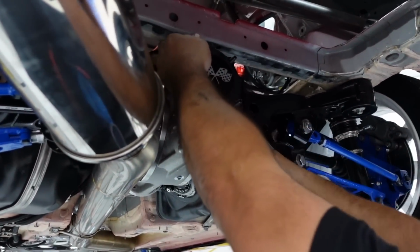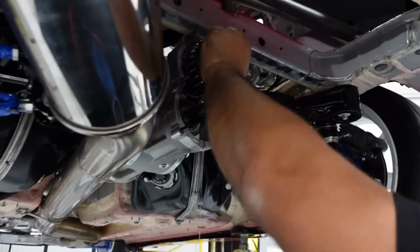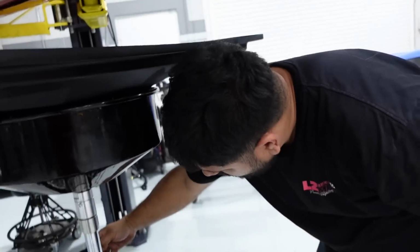6 bolts. 6 bolts, take them out, a bunch of fluid comes out. The cool thing about this, even though typically people will re-add fluid, the way that they're designed, you can swap the gears out and you can run it without adding more fluid because it's designed to retain enough for you to do it once, do a gear change without having to add more fluid. But got a little card that tells you the ratios, and we're going from, I think it was a 4.4